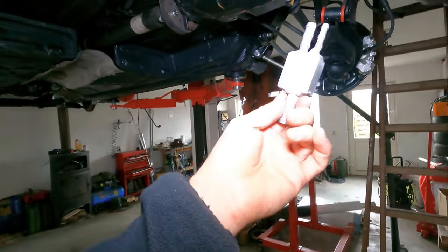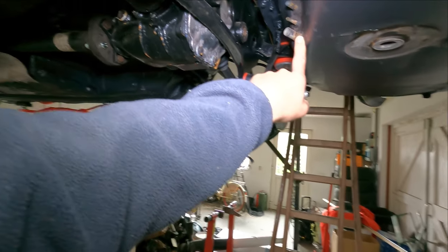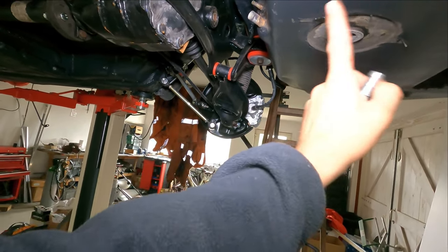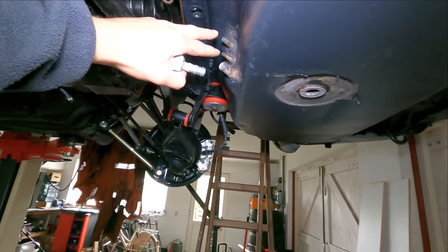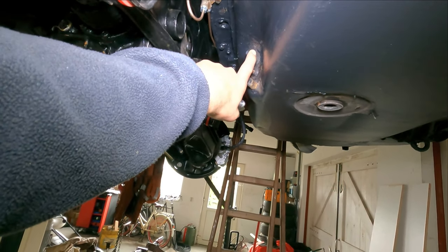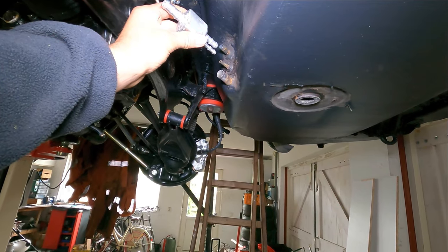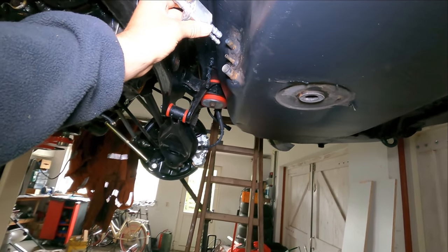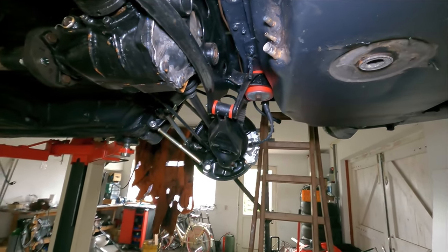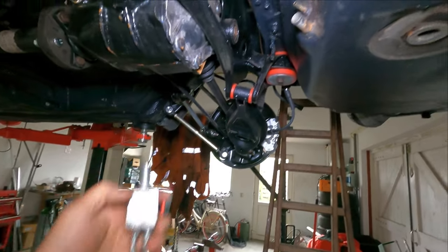This tee piece is for the return line. The feed line is the bottom one, which will suck fuel from the closest point to the fuel filter - there is like a swirl pot canister in the tank. The smallest connection just goes into the tank with nothing through it. This is the original return line, and this also goes through the swirl pot on the side - I checked with a camera inside the tank. I do this because I want to have as much volume line thickness as possible going back into the tank, so I don't build pressure in the return line.